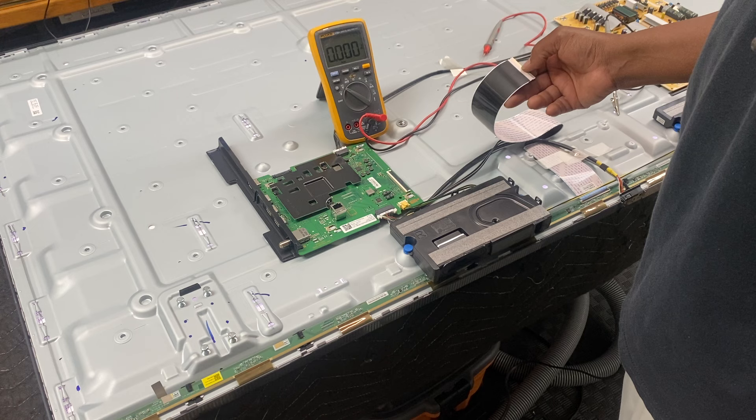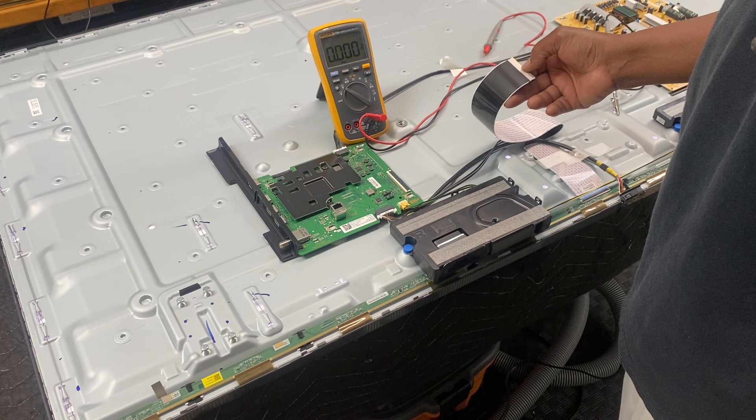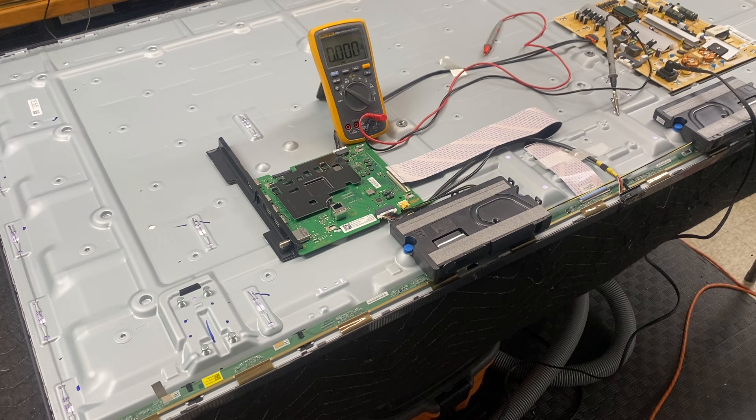Sometimes there's a trick you can do - you can cover a couple of these pins with tape, and the TV may stay on. If it stays on, then you know that the panel was the issue. But the TV is on right now and the panel is disconnected, so that's another thing to let you know the panel is the problem.